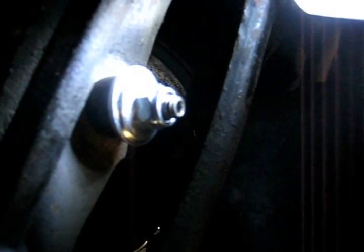Here is the top of the new shock after it's been installed. It's supposed to only be torqued to 90 inch-pounds, and we don't quite have an accurate way to measure that. The big bushing underneath the washer is not really that compressed — it's compressed enough that there's some force on it so the shock's not going to move around, but it's not greatly deformed either.